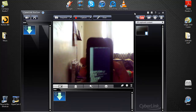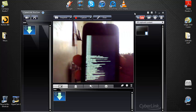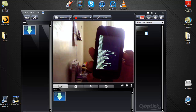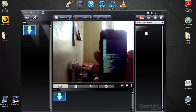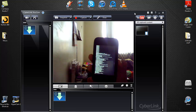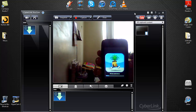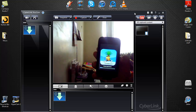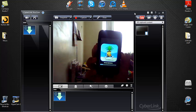I'm just using my webcam to record the device screen. You'll get a lot of random codes on the device — don't worry, that's just part of the jailbreak process. I've jailbroken my iPod Touch many times. After that you should see a pineapple logo, which is the RedSn0w logo. Then it should say 'Moving applications.'